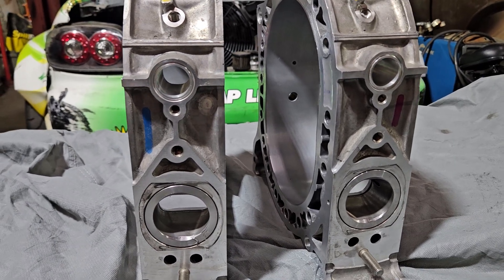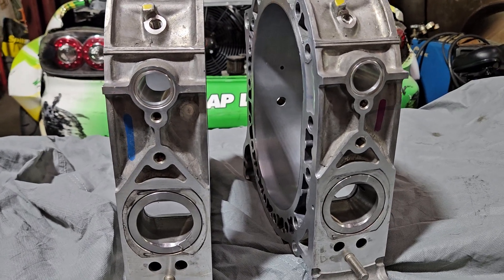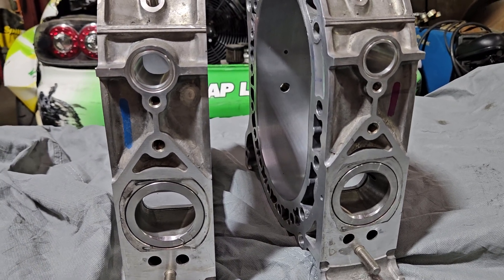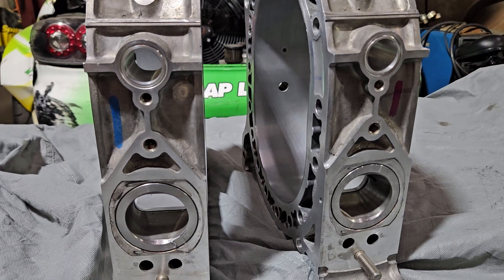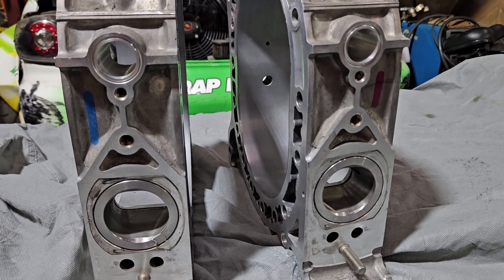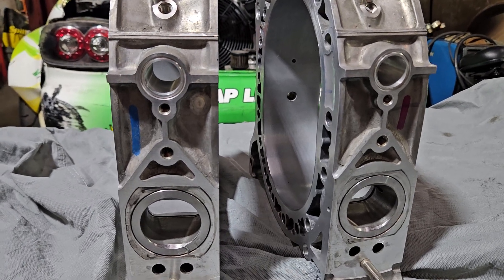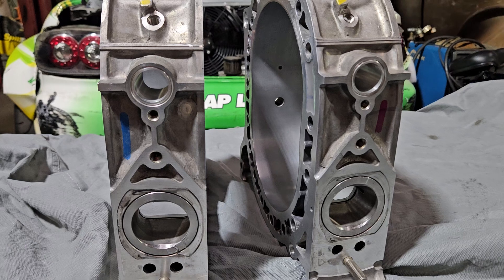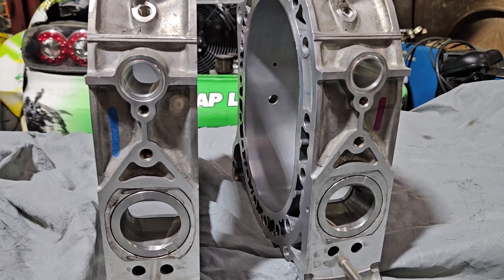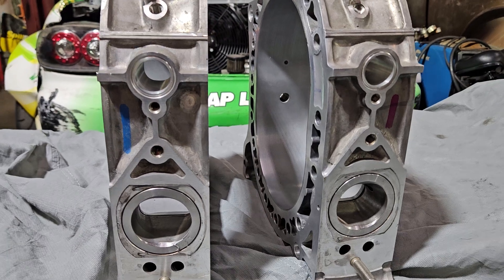There are infinite combinations, and that's why you do hear a lot of online discussion as to which port design provides better response, better horsepower, better bottom end. I think in most cases we can lump the semi-peripheral and most bridge ports in the same category: 5,000 to 10,000 RPM, very aggressive. A full peripheral is going to be even a little more aggressive, but you don't see a lot of those in turbo applications unless you're getting into four rotors, five rotors, six rotors — they balance out a little bit at that point. On your 13Bs and three rotors, you see a lot more of the semi-peripheral port in high horsepower performance, and more of the half bridge and street port in combinations where you need a little more drivability.